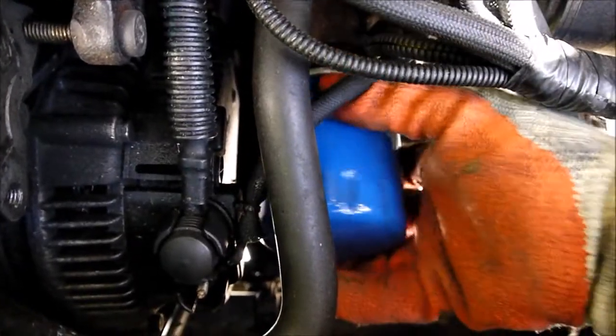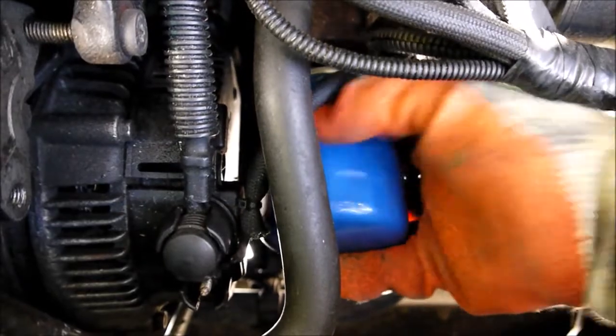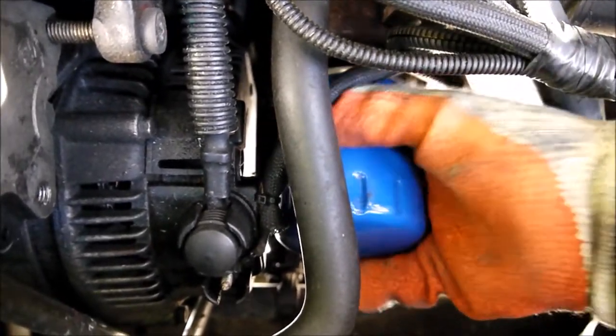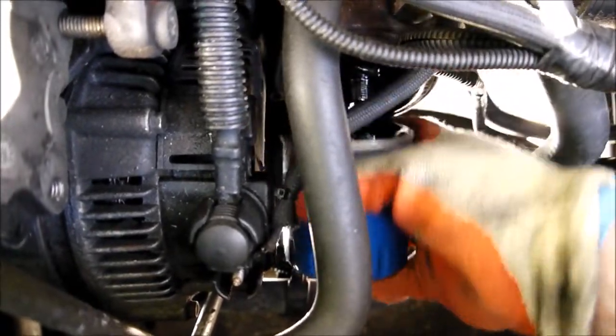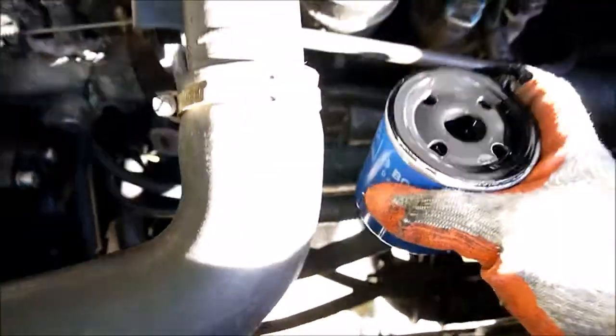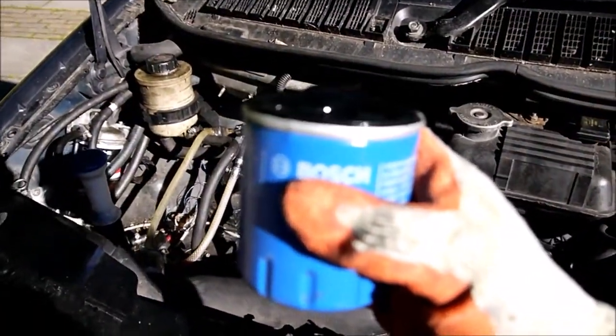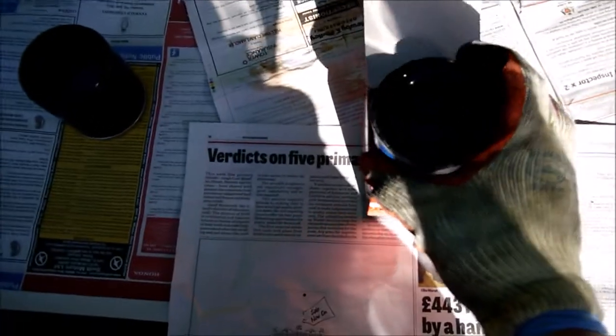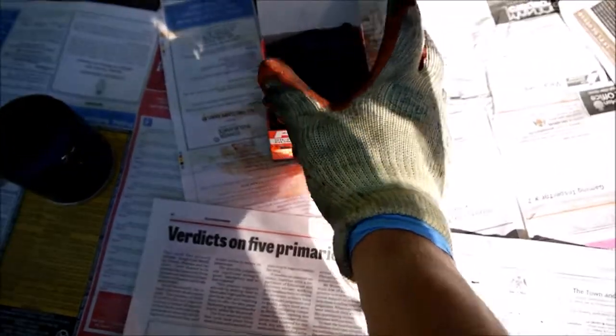Make sure you put plenty of paper down. As soon as it's detached from the engine I'm going to tip it upright so any residual oil isn't going to fall out. I can hear the oil draining out underneath — you can see it dribbling down the sump and the bucket is catching it quite nicely. I've now unscrewed the filter completely — tip it upwards and there it is. I've tipped it up so any more oil inside isn't going to fall out everywhere. I can pull the filter straight up and out in one go. I'm now going to place it inside the empty box to keep it steady so it's not going to fall over.